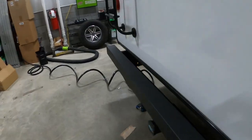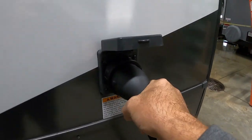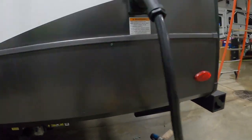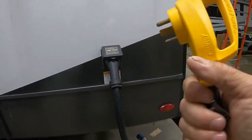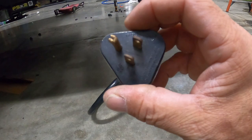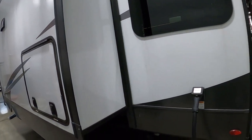Get all four jacks down with your unit level and stable, then hook up your power and water. You've got a big long 50 amp cord that plugs in here at the rear. These do twist to lock — go in at about 11 o'clock, wiggle it in, turn it to noon, and put your washer on. At the end of that 50 amp service there is a 50-to-30 amp dog bone in your convenience pack, as many campsites are just 30 amp. If you need to go from 30 down to 15 amp, there's a 30-to-15 amp reducer. Remember when running off just 110, don't run both ACs — run power accordingly.